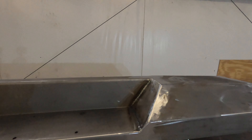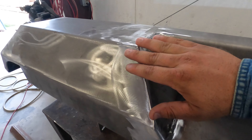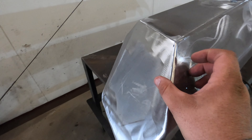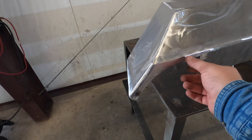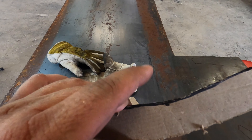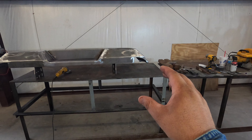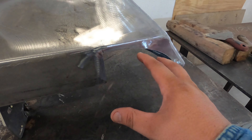All the grinding and sanding is done. It looks really really smooth — just knock down the high spots and then get in there with the flapper discs, knock everything down so it all looks like one piece. I went ahead and decided while it's out, before any paint, I'm going to close this gap here on the side I showed you earlier. I made a couple templates before I took it off the truck, leaving about a finger's width between the bumper and the truck. I'm going to cut them with the plasma cutter and see how they fit up.